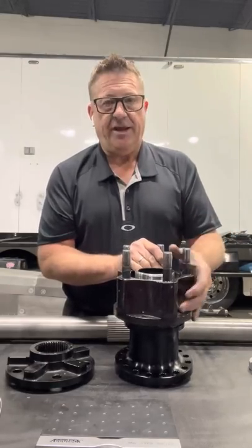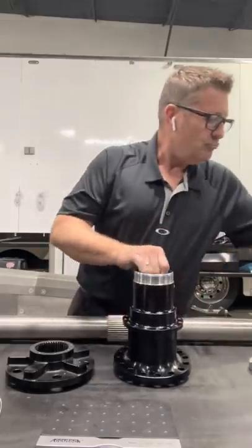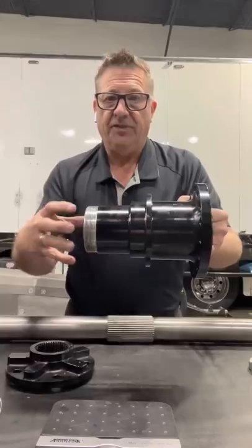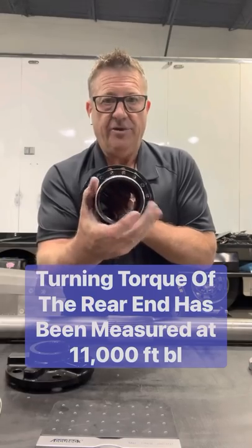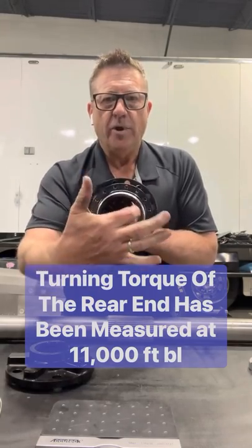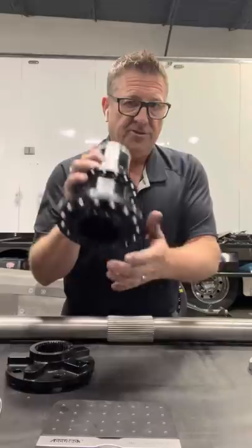The bearings are pressed up against basically a crush sleeve, so you get it pretty damn tight because you don't want this thing flopping around. What happens over time after hitting the gas — the axle flexes. There's no doubt about it. It flexes, and what it does is it makes this end wander around. You can see on the edges of a used one where it's actually hitting the side of the spindle. And the spindle is light — it's aluminum.